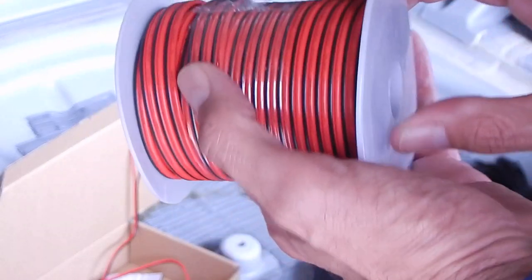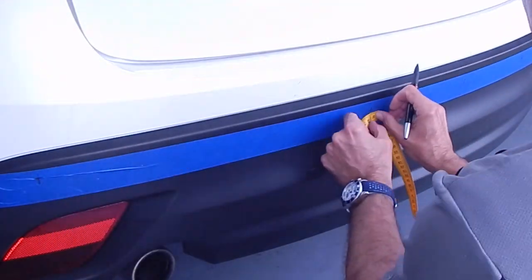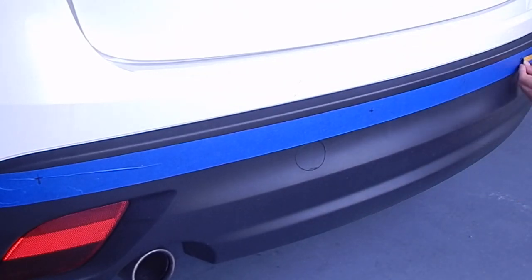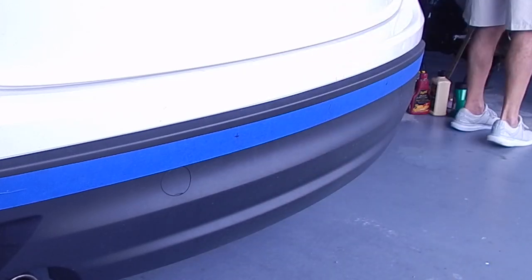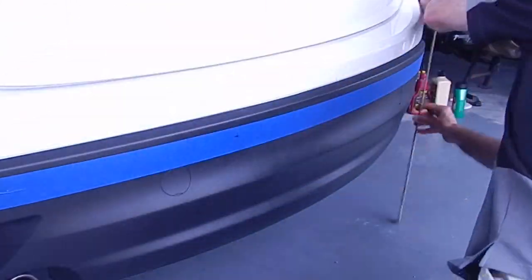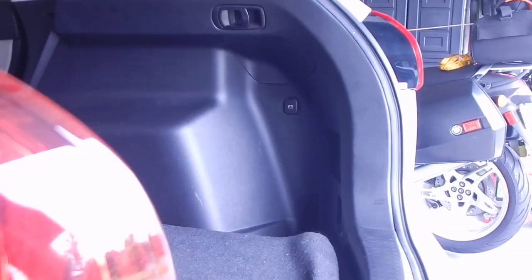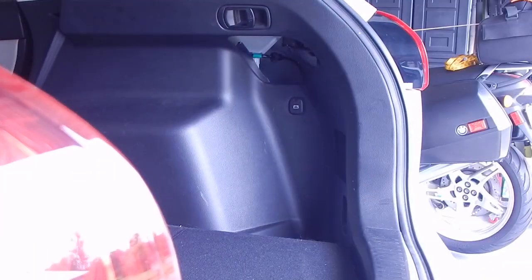You'll also need some wire, as the kit did not come with wire long enough for my wife's car, so I ordered a spool on Amazon and it came within a day or two. I spent considerable time measuring the bumper and put a piece of blue tape across where you want to insert the sensors — make sure there's nothing behind them, as some bumpers can butt right up against the metal frame.